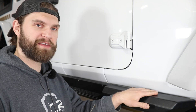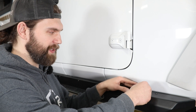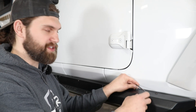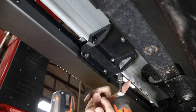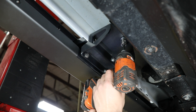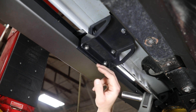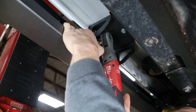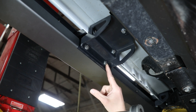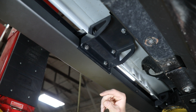With both steps in and tight, tighten up all the main mounting hardware. Start up top with the 5/16 button heads through the top flange — you'll need a conventional 90-degree Allen wrench due to clearance between the top of the slider and the body; work your way down and tighten all six. Moving underneath at mount location two, start with a 13mm socket on the flanged metric bolt, then switch to a half-inch socket to tighten all the 5/16 hardware at the pinch weld. If any aren't tightening up, reach in and temporarily hold the nut until it contacts the back side of the slider and the serrated flanges bite in.